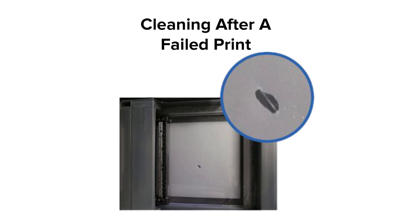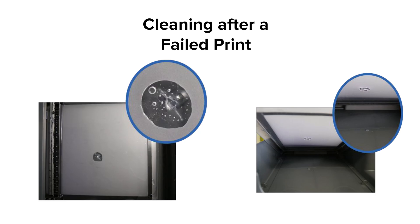Next, inspect your resin tank for any potential tears or punctures. The resin tank film is double layered. Punctures in the top layer will result in a transparent mark where air and resin is trapped between the film layers; inspecting the underside will show no mark or resin leakage. To prevent further damage, this resin tank should be replaced. A tear or puncture that goes through both layers will cause resin to begin leaking into the cavity of the printer. When removing the resin tank, check for drips of resin indicating a full tank puncture. Tanks with full-thickness punctures should always be replaced.